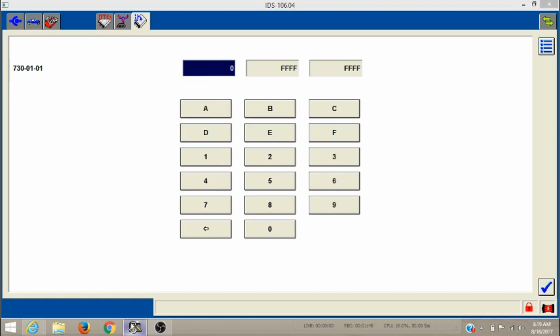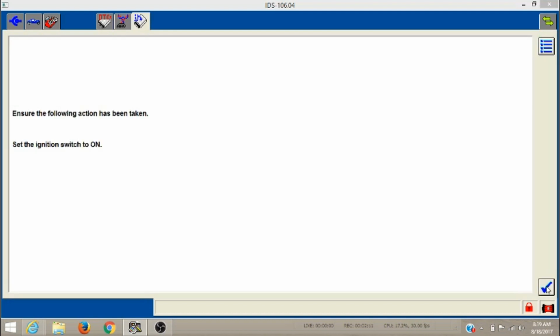Now what I was doing before, I was doing program module installation, and I wasn't doing as-built, even though I said I was going to do as-built. I'm just so used to doing it that way, I got confused and forgot. Basically what I did was I took the information out of the gear I put in there and put it right back into the same gear. So that's why it didn't work. I needed to take the information out of the old gear to put it in a new gear so the options would be correct and those codes wouldn't crop up.